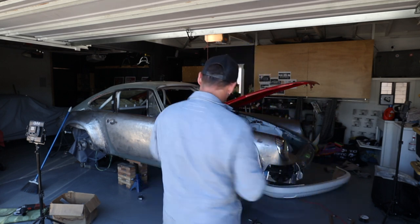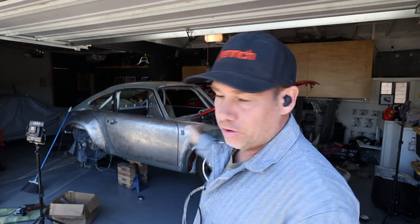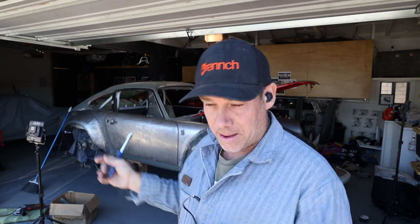I'm going to have to cut this front end off — so the thing I put together so well, I'm going to have to redo. I'm going to pull the fender off so I'll be able to see the inside seam. I'll cut it right on the seam, come back, put it back on the car, and see if I can position it where it's supposed to be.